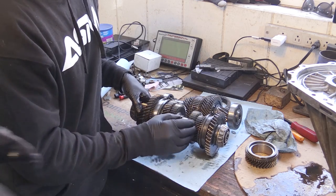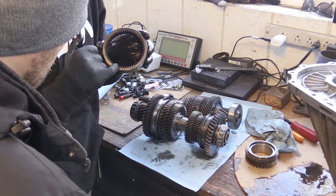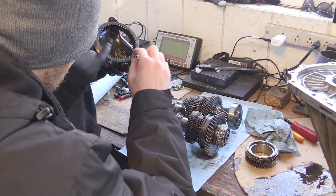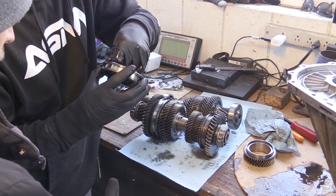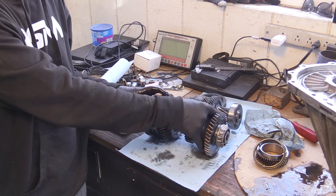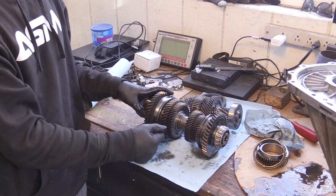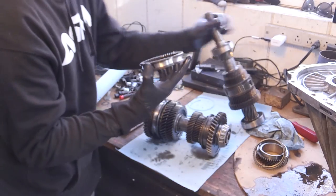For recommendations: for sure do the 5th gear synchro. I've been doing a lot of the Synchrotech carbon synchros — it seems to help lengthen the service life a bit. The sliders are cheap, like 35 to 40 bucks, so I usually do all new sliders. These little edges on the slider are supposed to have a triangle shape to catch the next gear, and they'll sometimes get rounded off, causing a grind. This one is the 3rd/4th slider. First gear feels good, second gear felt good, third is usually pretty good — the main complaint was really just 5th.